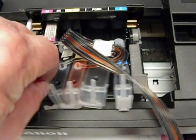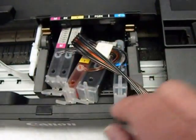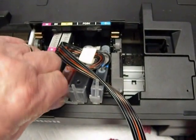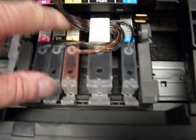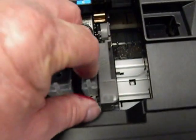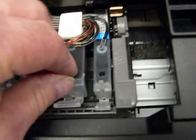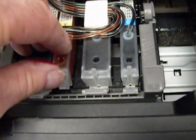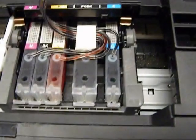Now here's where you might get some ink on your fingers, so flip them over and set them down in. Line them up with the color they're supposed to be lined up with. Take your time, don't be in a rush. Line them all up, but I'm not going to click them in yet — just get them all lined up in the correct slot. Now I've got them lined up. I want to push the back in; make sure that's down. That's critical — if you don't, it'll pop up and lock the cartridges on you. So I get it on an angle going in, I should hear it click in. Make sure you've got it in tight up front, then you can click it in. They're all clicking in.